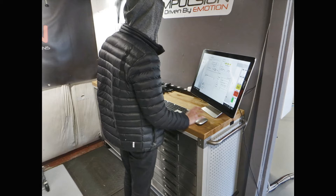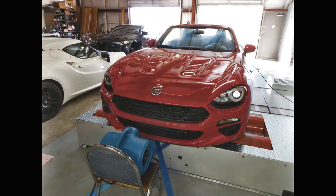That's Toby, my son-in-law — he's helping with the video today. We're going to do one dyno pull with front and rear rollers synced, then one pull with only the rear rollers turning, so we can see what the car does. We're not specifically testing for power here, so the exact mods or testing conditions don't matter. What does matter is that these two runs are back to back with enough time in between for temperatures to even out. This car does have a tune on it, because the question is: will a tuned car pull back power on the dyno?